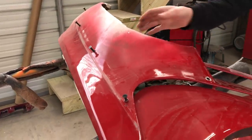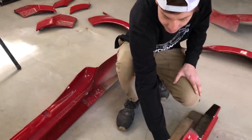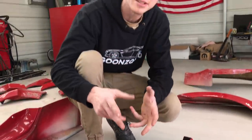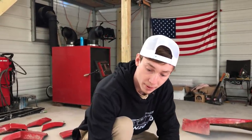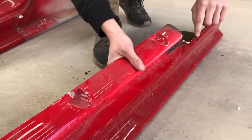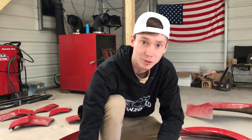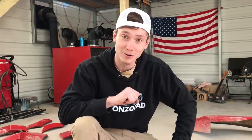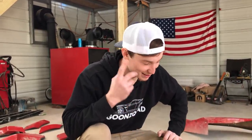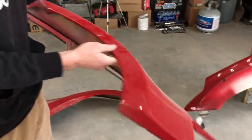I'm thinking about repriming everything — we might just quickly sand it down with a 180, which will move a lot quicker, and then just primer all the parts, sand them down smooth again so we'll have that pristine finish when we paint them. We're definitely going to paint that area red so when you open the hood everything looks almost OEM. As for the side skirts, they're not in their best shape — some of this stuff cracked. This car looks to have been repainted twice with the wide body. The original color used decent paint, but then there's a slight tape line and it changes into a dark maroon red, which is not appealing. We're definitely going with the OEM paint, maybe with some metallic in it. The main wide body pieces that go over the fenders are actually not in that bad of shape.